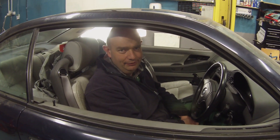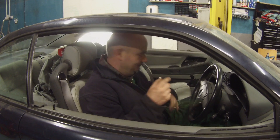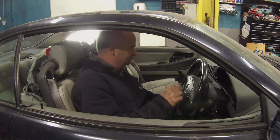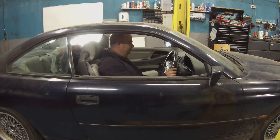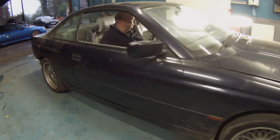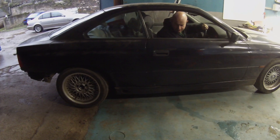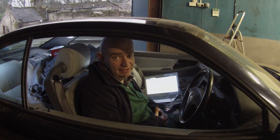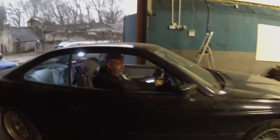First roll of the Tesla-powered E31. If this is my last transmission, the car goes to Dave. Selecting reverse — aim for the Subaru. Pretty great, huh? I had to do a few parameter tweaks because the original high-voltage parameters were set for 360 volts and we're at about 230 now, so we just cranked up the boost a little bit, and we should be able to drive forwards.